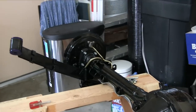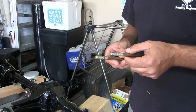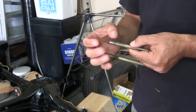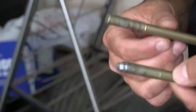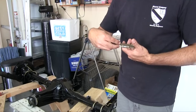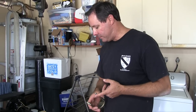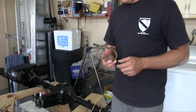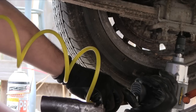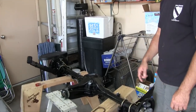The other side had a rough time with one of the U-bolts — put the U-bolt on and it was difficult to get the nut started. I cleaned these up and the threads were fine. What ended up happening is a brand new nut I had turned out to be damaged — it totally ruined one of my U-bolts. I tried a die thinking it was the U-bolt, but it was the nut. So even though the threads were fine, they're now history. Then we went to the green car and got a new U-bolt. I'm going to powder coat it, and I've got to do that before I can put the rear end back in.